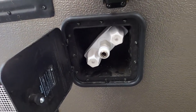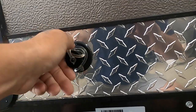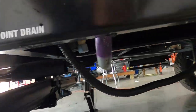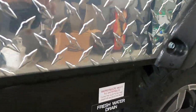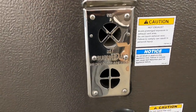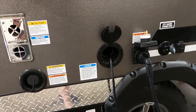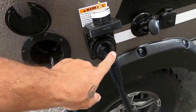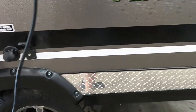You have an outdoor shower with a spray-port hose that hooks right on. There's a low-point drain for that, and underneath there's a freshwater low-point drain. There's your freshwater tank. This is the flue for your furnace — make sure it's never blocked when you're running your furnace. It does get hot. Here again are your AC cord, power cord, city water connection, and cable from the campsite — you can put a TV in here.